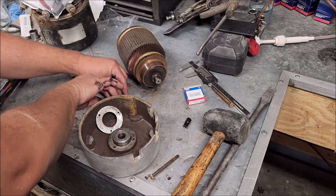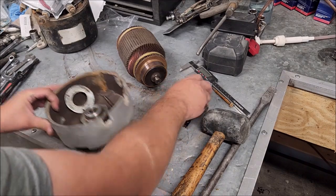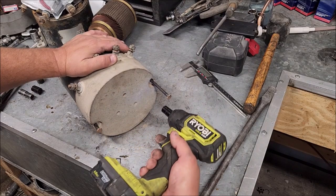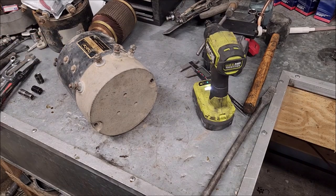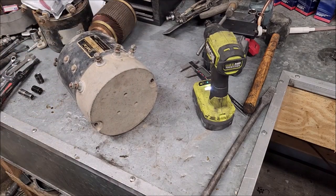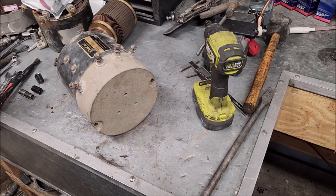The plan was to put new brushes in it, which I already have, and then put the motor back together. But now that I see that motor, there may not be anything wrong with it, which means my problem lies elsewhere. This problem has been here since we got this cart. The first rear end - the guy used to off-road the cart a lot and he put a hole in the bottom of the rear end casing so it wouldn't hold oil. So it got a new rear end with new bearings, seals, new axle tubes, and brakes. The only things reused were the rims and this motor.